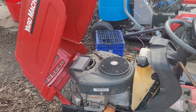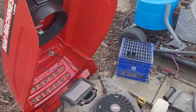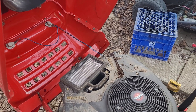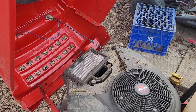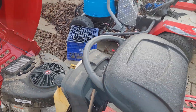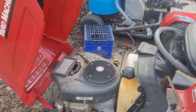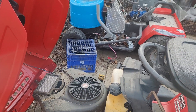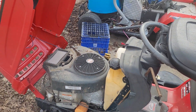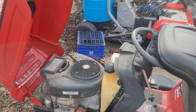The engine is cranking over very slowly — you can see it's struggling to turn over, but the carburetor is firing on both machines. This one most likely needs a starter, that's my guess right now, or the valves need to be adjusted. I'm hoping it's not the compression release. I put my hand over the intake and there was no real change. I've never really heard of the compression release going out on the V-twins, but it's possible. Worst case scenario, this is a parts machine.